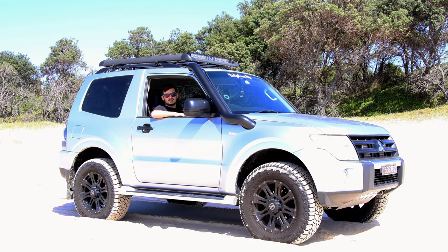The problem is when you're off-road, in sand, or in snow, the traction control will literally bog you down. I'm going to show you on the beach what the car does with the traction control on versus off, and also with just the ASC off — to see whether there's any difference between turning off the ASC versus turning off the full traction control system, which also turns off the ABS and ASC.